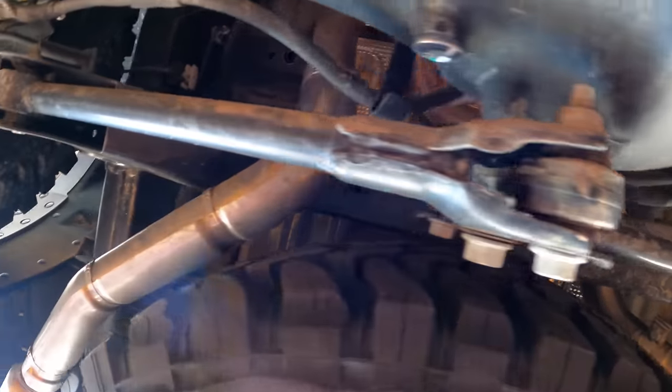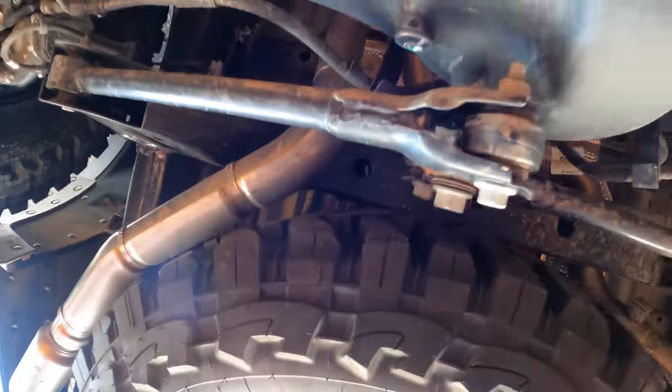I'll probably check the clearance again when I take it for a drive. The other day when I did a clearance check, I thought I might have just had to remove the front mud flaps, but they're actually touching on the inside of the guard at full lock. As long as you do the same setup as this, you should have the same result. 35 will fit underneath the back — just. Rear fits on fine. The front, you will need to trim the inner part of the guard, just where the wheel comes back. With a lift you might not need to, but as long as you're doing the lift correctly with the valving re-change. It really depends on your exact setup — what wheels, tyres, offset.